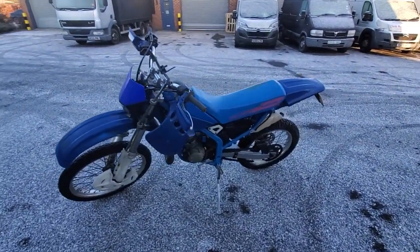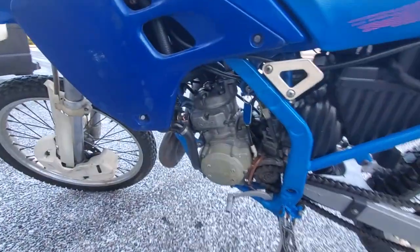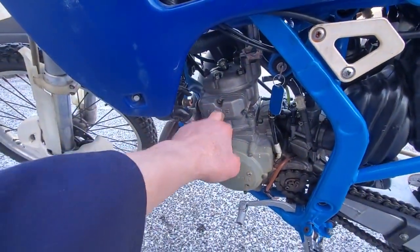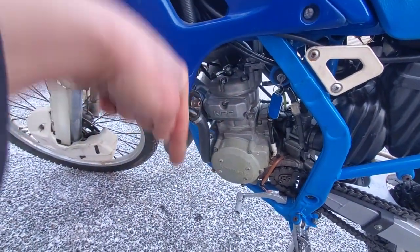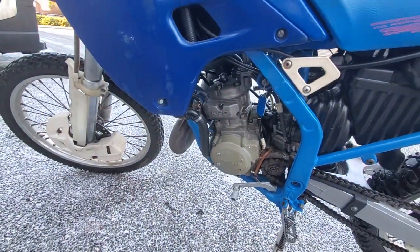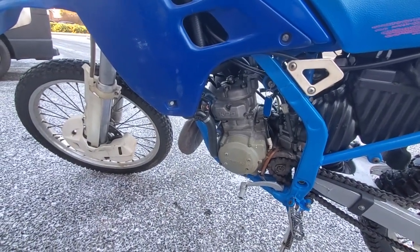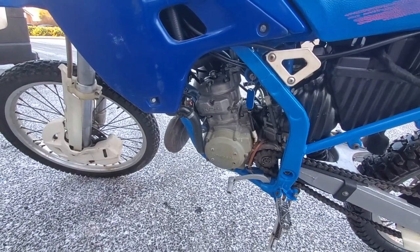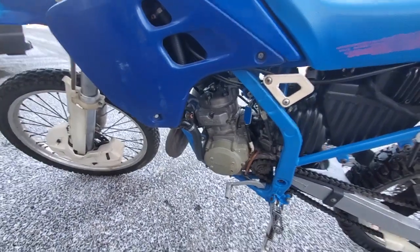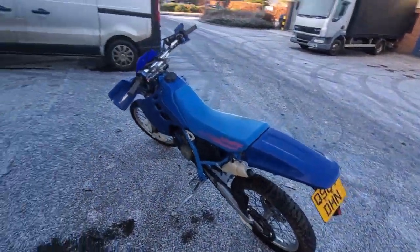The engine has a tiny little bit of a top-end rattle — it's not terrible, and to be honest these engines do that a bit. This Kawasaki engine has the KIP system, a power valve system inside the barrel. It's little cylinders that fit in the barrel and rotate, like the KR1S of the same era and the KX250 I had in a few weeks ago. Those power valves do tend to rattle a little bit in the cylinder, so a top-end rattle on these isn't always the end of the world — it's not always the piston.